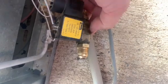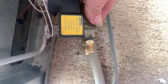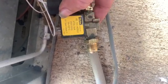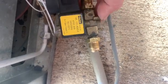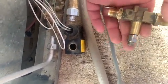So this sits inside. Try and do all this one-handed. So that sits inside, and the more you turn the gas knob for higher power, the more electricity goes to this, which then pushes that pin up more. So if I put it on low, the pin drops, and off, the pin completely drops. So that's my problem, this isn't working, this pin's not doing anything.